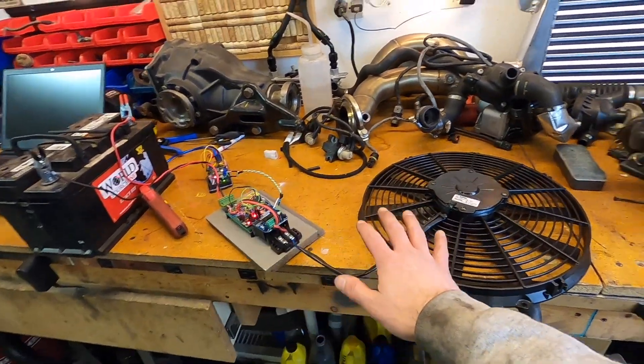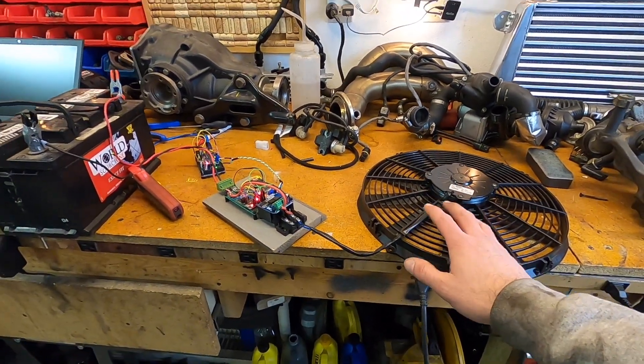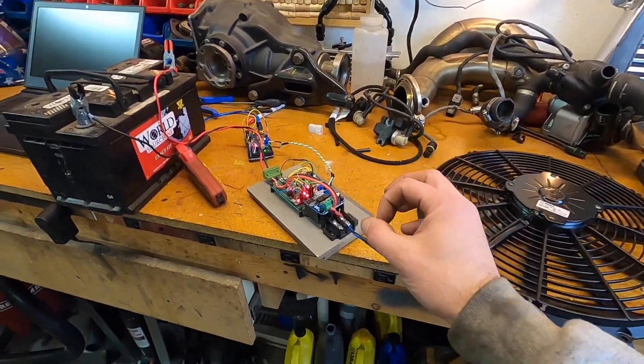The fan that normally works under direct current power from a battery or a relay is actually going to be acting as a smart fan, conserving energy to keep the engine cool at the exact temperature it needs to — as opposed to a temperature sensor turning a relay on and off and having this fan cycle high and low. It's actually going to be spinning at almost infinite speeds in order to cool the engine to the exact temperature needed. With me is Ralph Wieland from Wieland Consulting, and we're going to be using the E30 N54 as a test bed for anyone who wants to more efficiently cool their engine through a pulse width modulated signal.